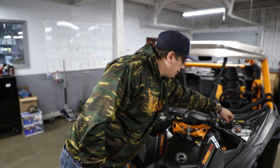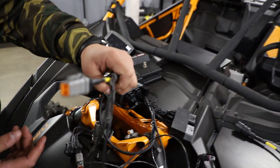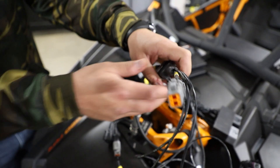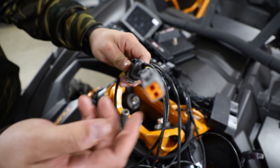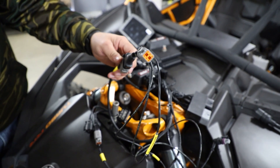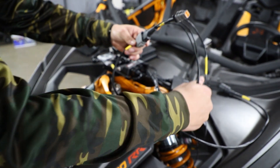Another thing is we have spare outputs — we have six more pins here. The M150 basically uses every single pin and connector in the M130 to control it, so we get a couple extra here if we wanted to add a pressure sensor, an output, something like a nitrous control, or if you wanted to control a different fan through a relay.